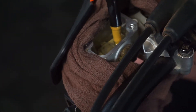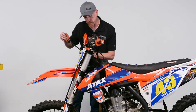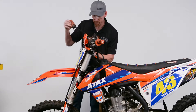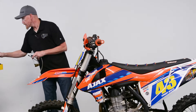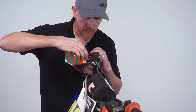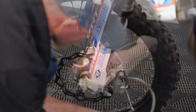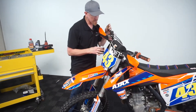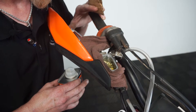Fresh fluid will help you see it better. Then we're going to pull that out as well. You'll notice in the center of this master cylinder reservoir there's actually a little plastic cap — a little splash cap. What that does is keep fluid from shooting straight up in the air into your face, and also kind of keeps air trapped around the entry hole for the bore of the master cylinder. So we're going to top this back off and attach our hose to the bottom. We're just going to run this all the way up to above the master cylinder. Keep your reservoir topped and watch the fluid level. You can give it a couple light pops on the lever if you want — you don't need to pull it full range.